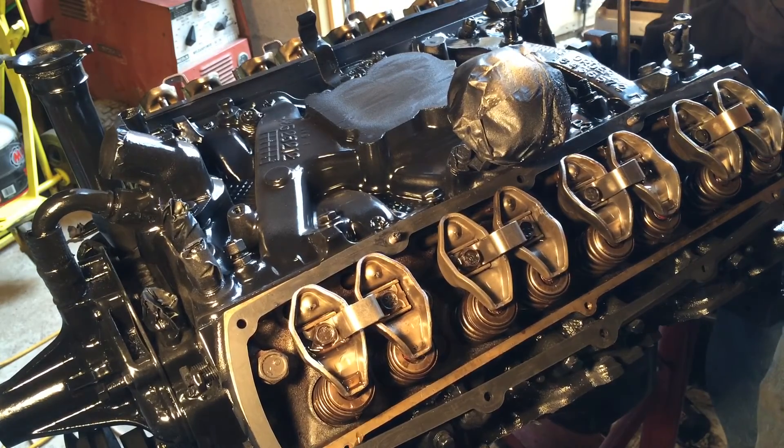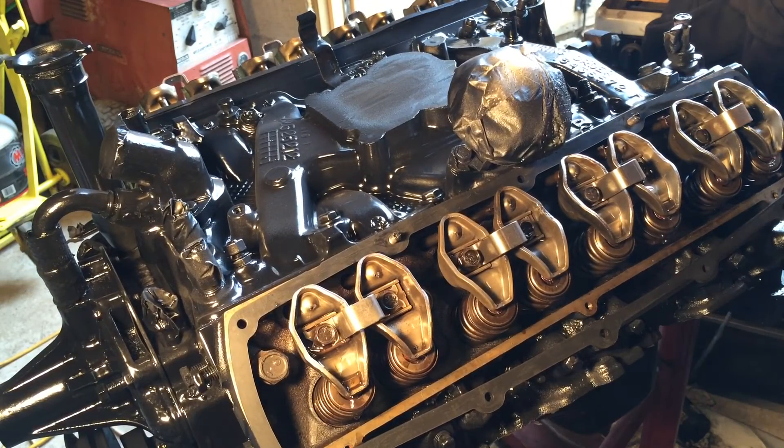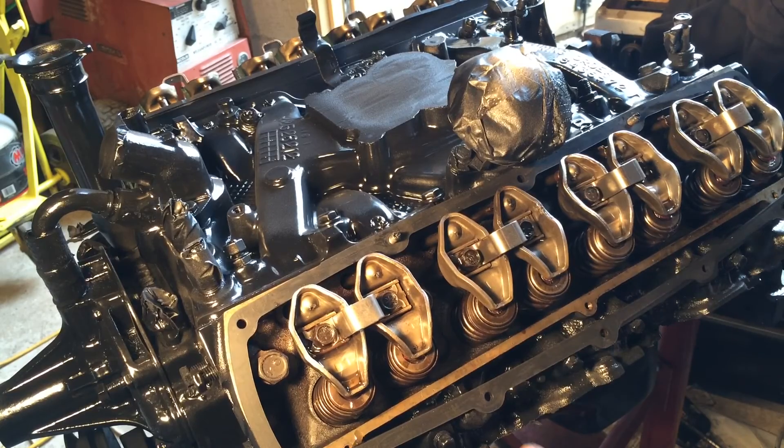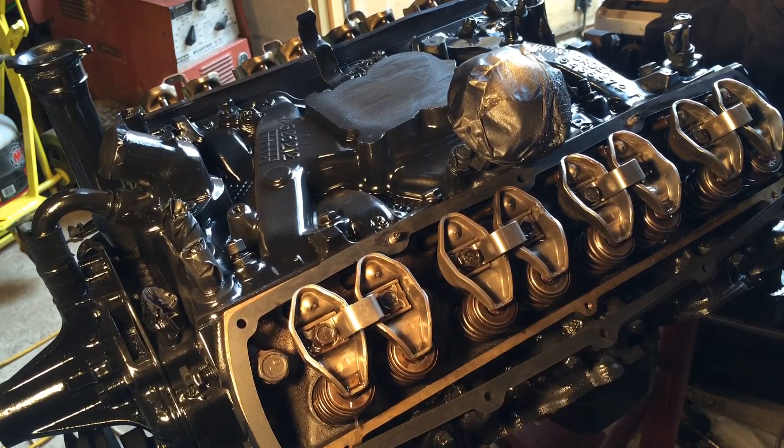And that's pretty much all there is to it. My drill has pretty much had it, but that's all you look for — just the oil coming out. This one was actually squirting out. But that's all there really is to pre-oiling your engine, and that kind of ensures that everything will have oil whenever you first turn that key. Alright, just wanted to show you. Thank you for watching. Bye.